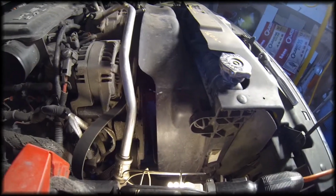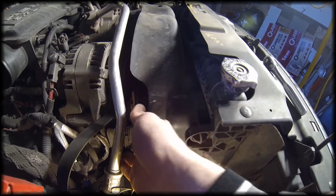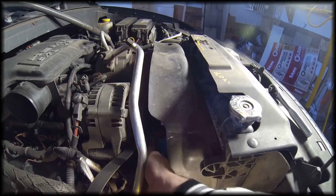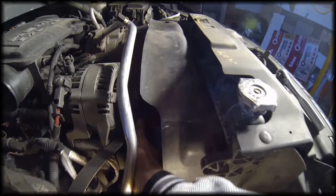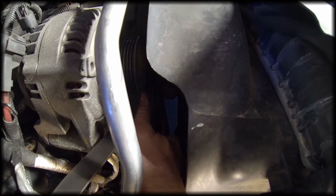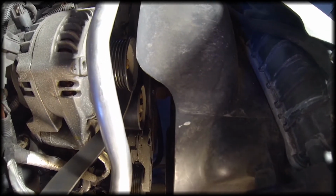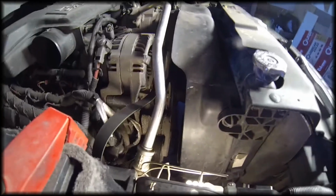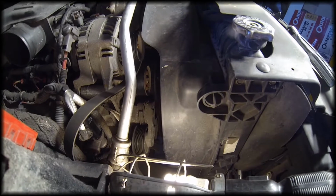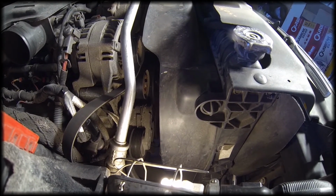That pulley that we just spun down below, it's a little bit noisy, is the same pulley as the one that's up here, identical rather. And if we try to spin this one, see that it spins freely, but it's not nearly as noisy. So I am going to replace the pulley on the lower side, I believe, and that should take care of it.